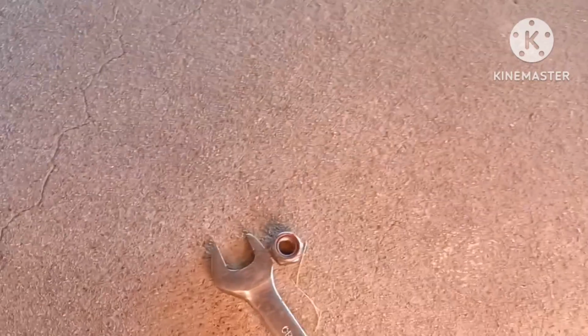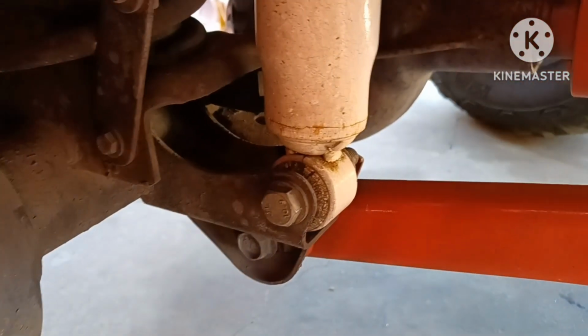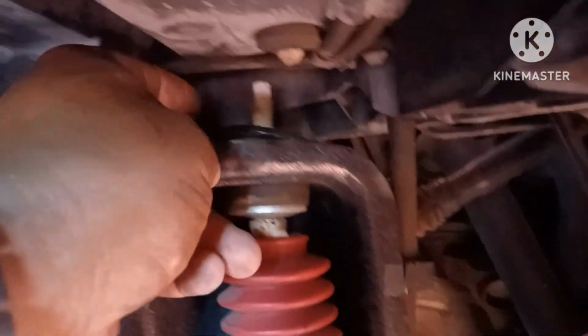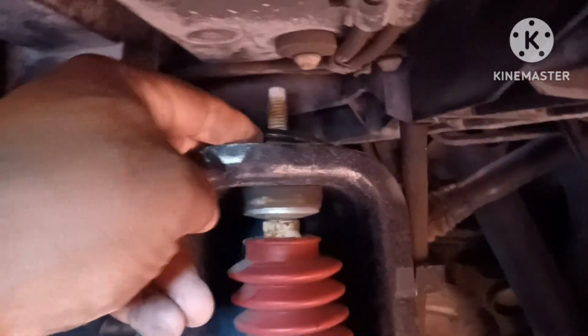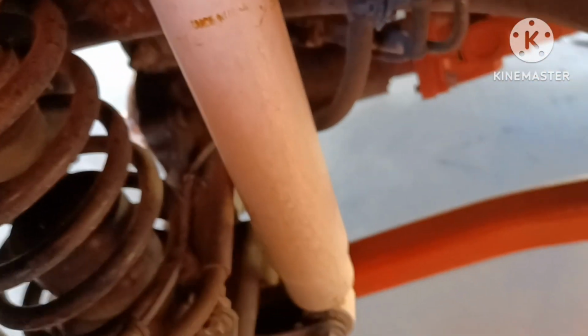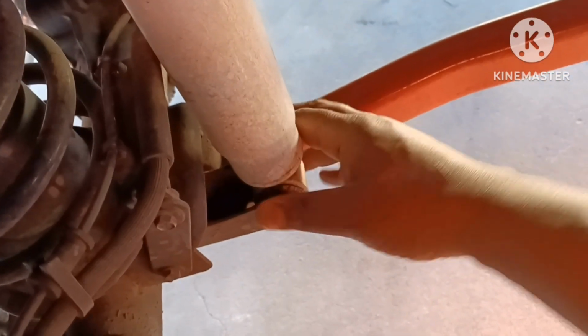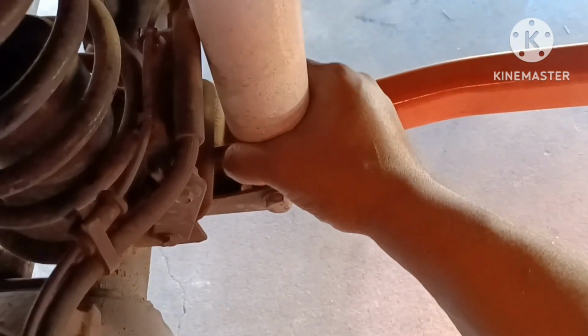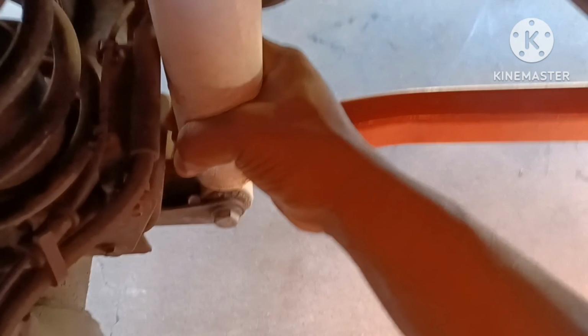Okay, so I got that loose down there. So my nut's on the ground right there. That's the nut on the backside. And that's loose. I can just slide that out. On the top, I've got that nut off up there, and all I have up here is, you know, the little bushing. So I can take the bushing off once I drop everything out. So the first thing I'm going to do is, like I said, this pin here, it could just slide back out. You see how it moves like that? You can kind of lift up a little bit, or you just get a mallet and tap it out, and it'll come out this way over here.